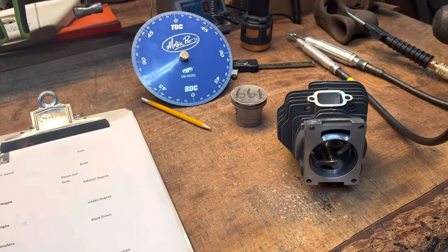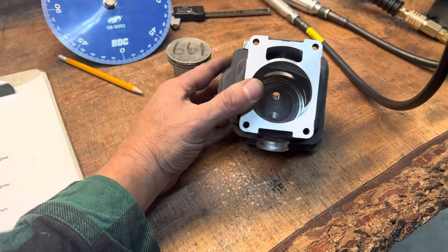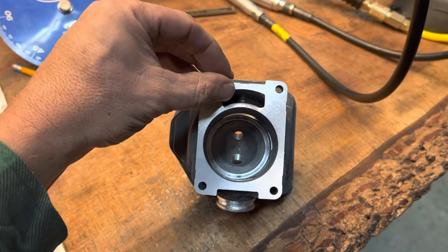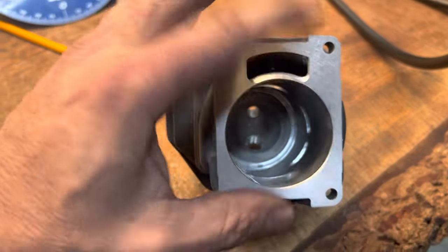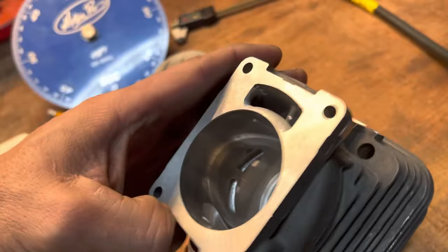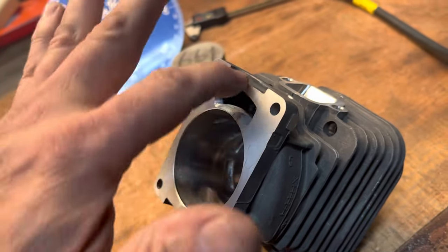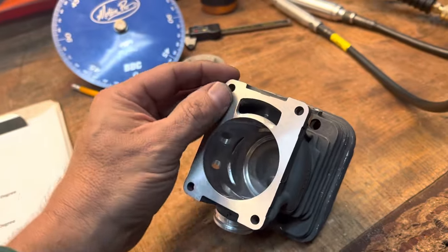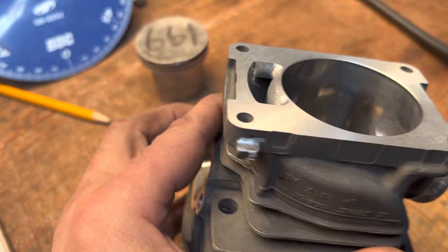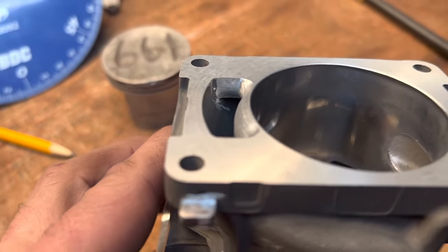I just want this thing to flow and I go from there. This is a 661 cylinder — I decked it. This is the lower transfer here, and I didn't get crazy in there. I was just making stuff flow. The air's coming around here and transferring in, making a transition. I don't want sharp edges — I picture myself as the air flowing, making a nice transition down in there instead of square edges.